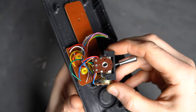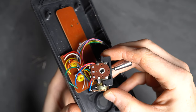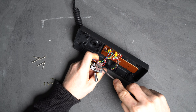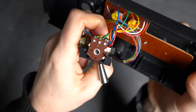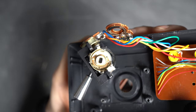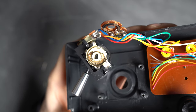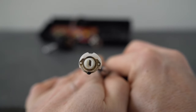You'll need to remove the outer brown circuit board of the potentiometer from the damaged axis. This is held in place by four small metal tabs that are simply bent over it, so gently prise them open with a thin screwdriver head until you can remove the board — I actually only had to open three of them on mine. With the board removed, you'll see a white plastic nut over the joystick axle. The spring goes on the other side of this, so you'll need to gently coax this off the axle using a thin-headed screwdriver.